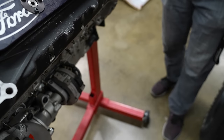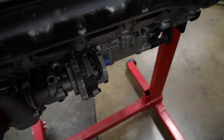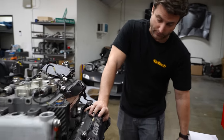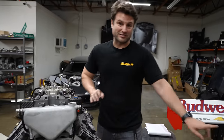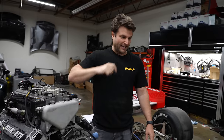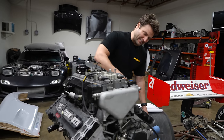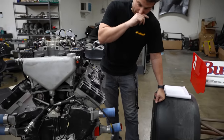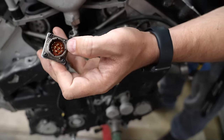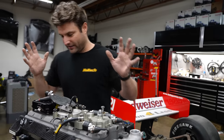All the fuel injectors are mapped out and everything needs electrical power. The alternator scares me for two reasons: I don't think it has self-regulation controls like most alternators, and with how small it is I'm afraid of how few amps it generates — I'd guess maybe 70 amps. This car doesn't have cooling fans or electric fuel pumps; it uses a mechanical fuel pump. Like the famous video of an F1 car at Goodwood overheating because it's sitting still — IndyCar same thing, no fans. The electrical demand is very minimized because the big ticket items aren't there. The alternator connector has four thick 16-gauge pins and eight 20-gauge pins — 16 gauge can probably do around 12 amps each.